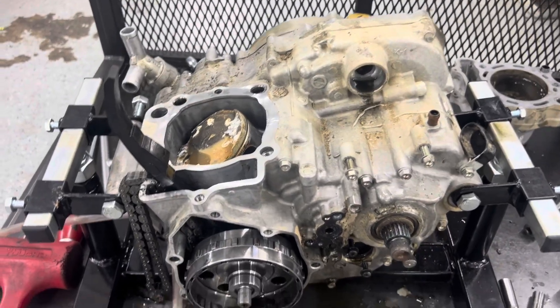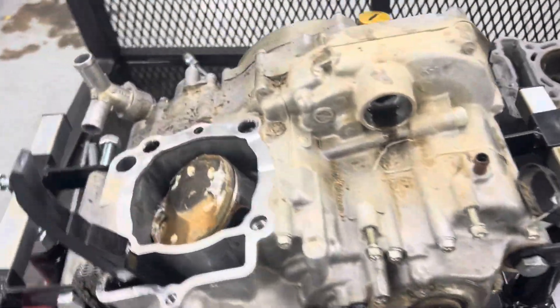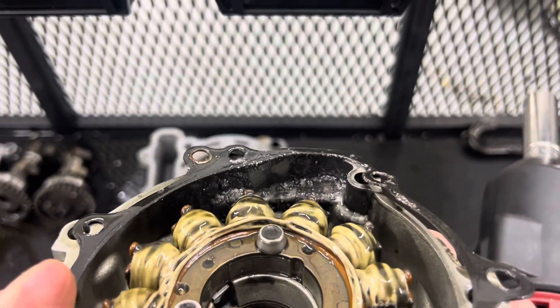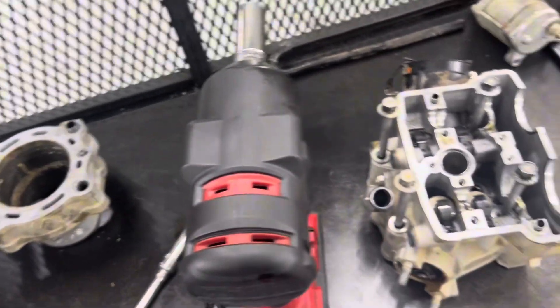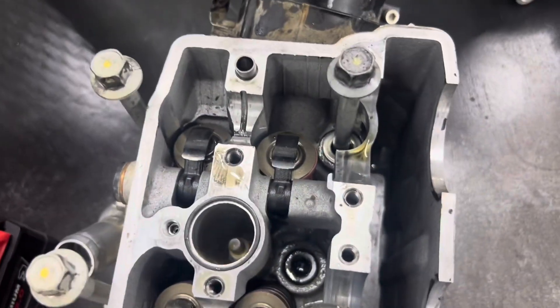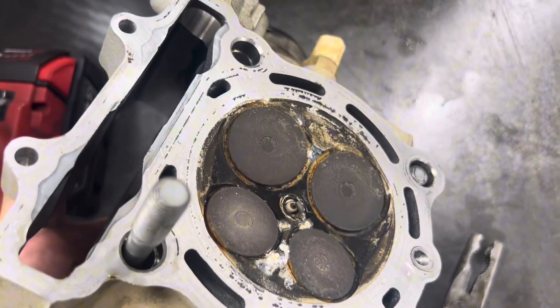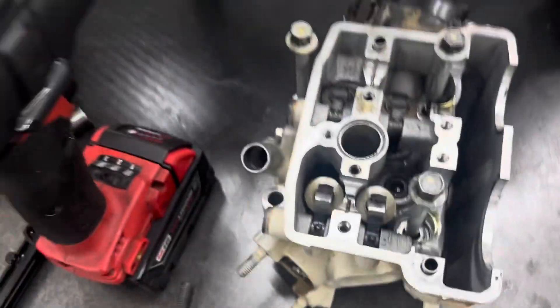So this is where we're at when we stopped - I got some other stuff to do. But anyway, we found quite a bit of metal in the stator side, which I believe is from the clutch plates. The head isn't crazy but it is dished out, so the head's done obviously. Most of that is just from sitting and washing it, but anyway we're going to keep going.